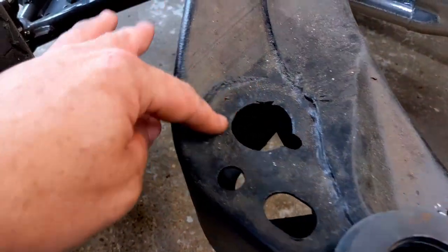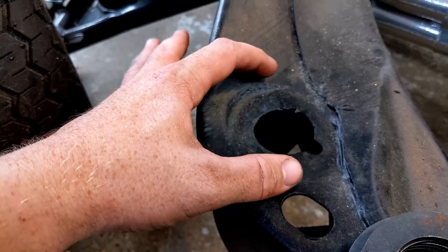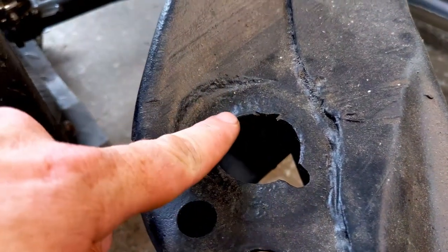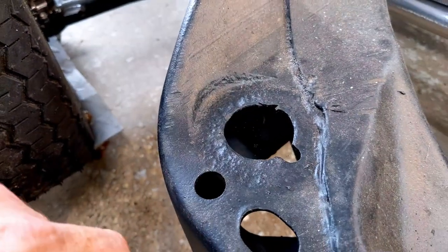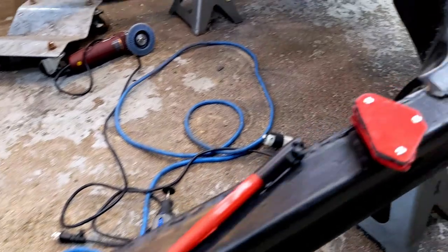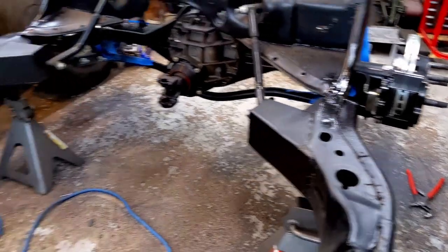As we can see here, this is where the body mount sits — in this hole. There's a metal box that actually goes off of the firewall and that's where the water collects. If we look in here real close, we can see this one's been cut a little bit, but all this dimpling is from rust starting some years ago. They should look something more similar like this — nice and smooth. The rest of the car is like that too. You can see back here, these are super solid, and it's the same in the back as well. So the biggest problems are these two front ones.